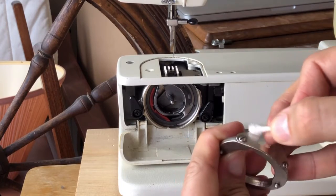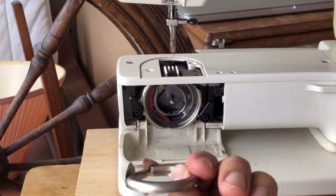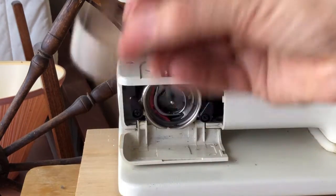Before I take any alcohol, take your lint brush first because a lot of this stuff could be loose and the best way to get it off is just to brush it. I've got the stiff bristles going around — front side and top. Most of it came off; there wasn't a lot of oil in there. Now I can take my cotton swab dipped in alcohol and go in, pulling it around the different nooks and crannies of this ring. It may seem like going the extra mile, but remember this ring holds your hook inside the race — it's not a trivial part.